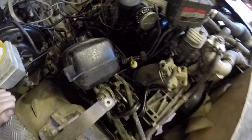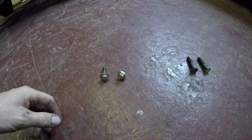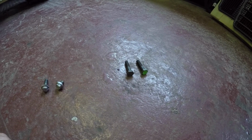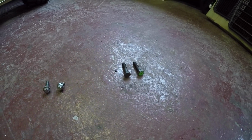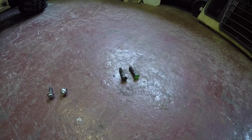Yeah, so I'll get the chain on it, undo the couple of pipes and exhaust and engine mount and steering, and that's it. Whip her out, mate. Nasty, but they're out now anyway. So I'm going to put 17mm headed high tensile steel ones in. Put some copper slip on, so they'll come out easier next time.